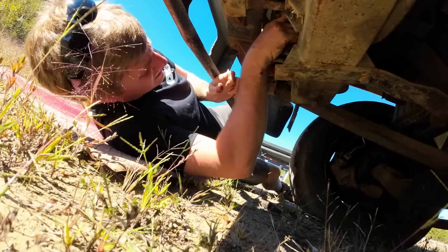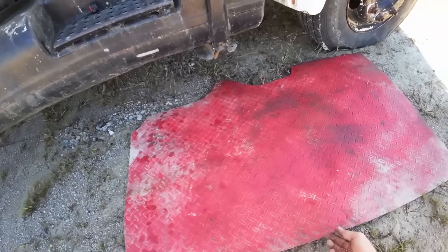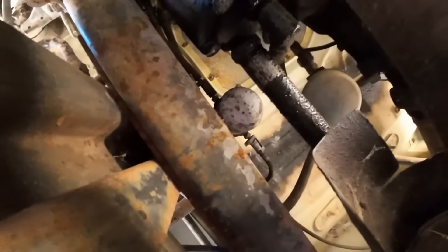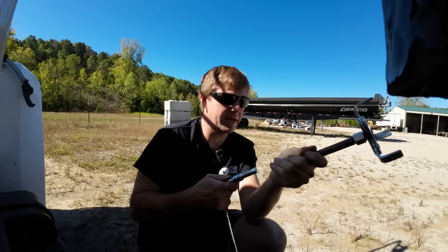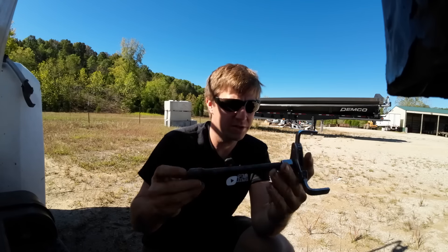I think the fuel filter is going to make a pretty big difference. We're just going to play the old follow-the-fuel-line game. Looked online — looks like there's several options of where it might be. I don't think I can fit under that, but it's already flat so I don't have to worry about it smashing me. Am I the only one that thinks about what happens if a tire blows out while you're under it? Is that the filter right there? That's fuel on. This is the exact filter wrench for this situation — it was actually gifted to me by a subscriber maybe over a year ago. It's a half-inch drive with little teeth that tighten down onto the filter as you turn it.